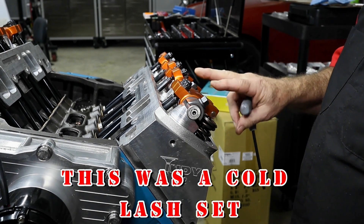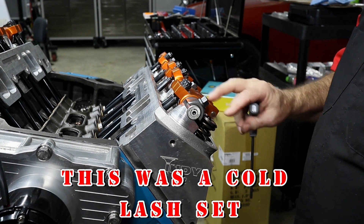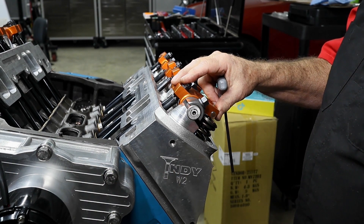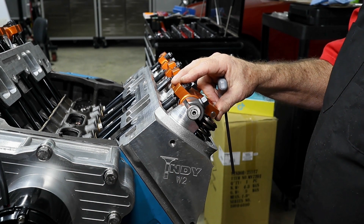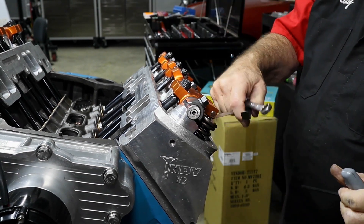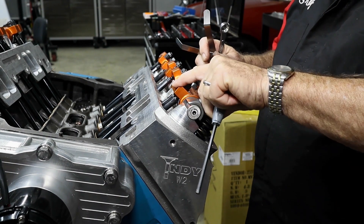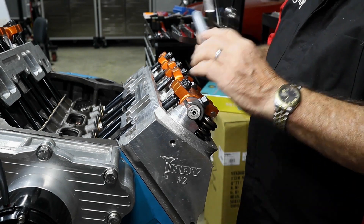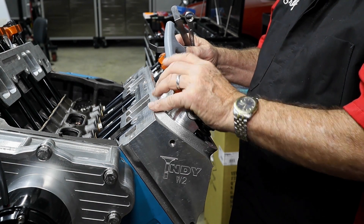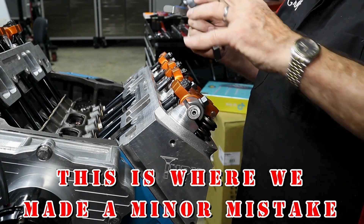What I've learned on these in the past — and this is the first motor I've actually built with a full roller — is you have to have a little bit of space initially when you first set the valves. They'll probably need to be adjusted every time this vehicle runs because of the way it's designed. So it's 18 for the exhaust and 16 for the intake because of the higher heat? Well, you're going to have some expansion. Right now it's going to have a little bit of play in it — you want that. When this thing heats up, everything in here is going to get hot and get tighter. What you want is zero lash. We're setting it at 16 thousandths because once it gets hot, it's going to tighten up and things are going to expand.